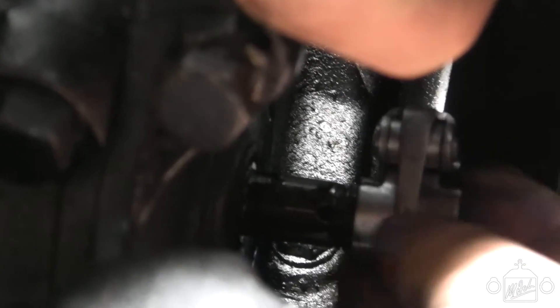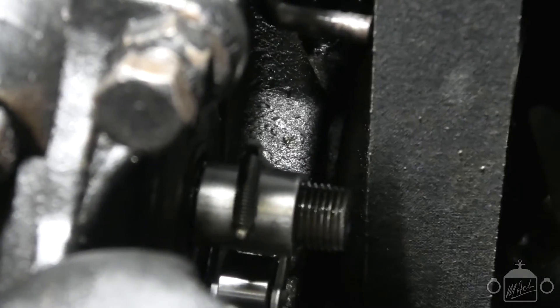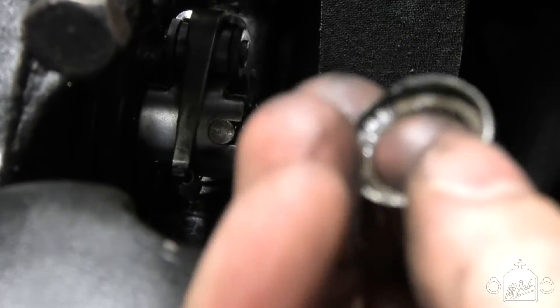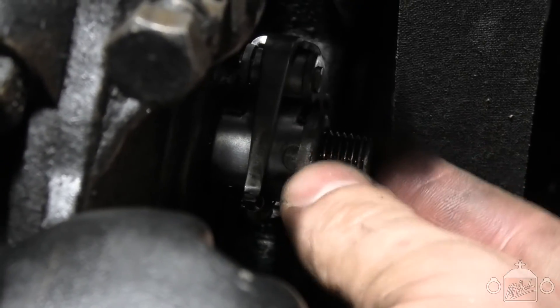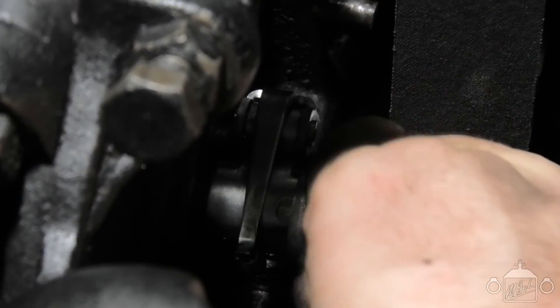This little slot here — we want to line that up with the hole on the shaft. Slide that on. Line the hole up like so. Grab that little tiny pin and bring the roller around — goes in like so to hold the roller in place. Then we bring back our retaining ring and slide that on so it tucks in over the top of the pin to stop it coming out. And lastly, the nut — tighten that up.